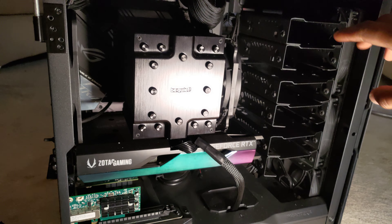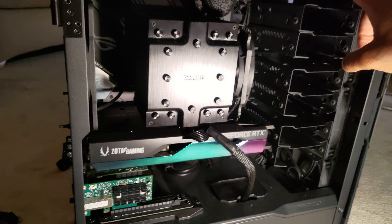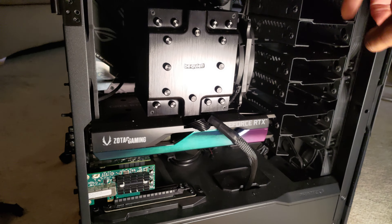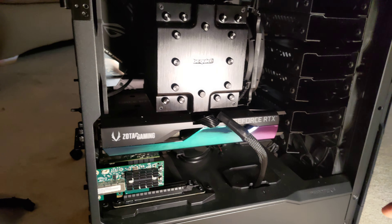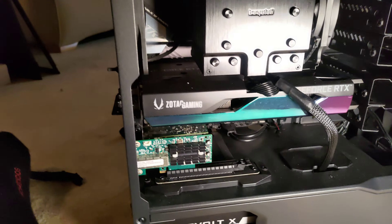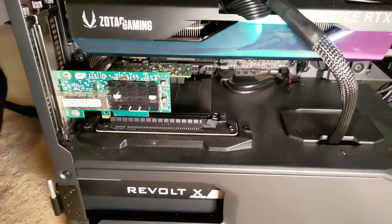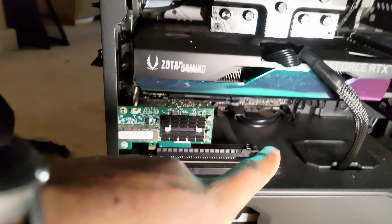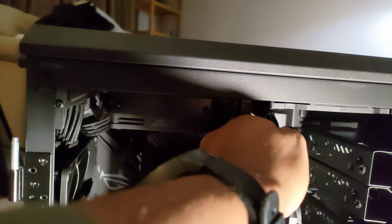I just got back, but I couldn't help myself. I just finished adding the three and a half inch drive bays, so that makes for a total of eight three and a half inch drive bays and two and a half inch bays on the back. I also added two 10 gig SFP+ NICs, Mellanox ConnectX-3s, a little motherboard speaker in there just in case stuff goes sideways, and cable extensions.